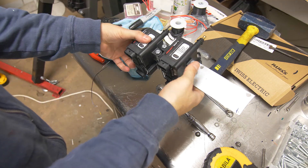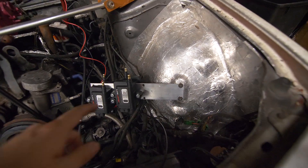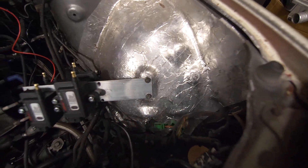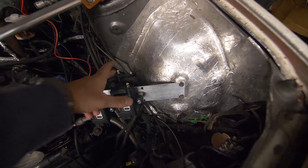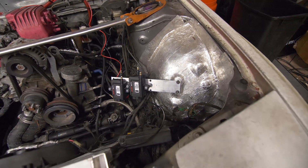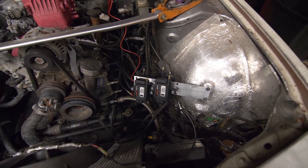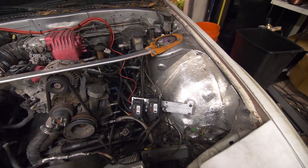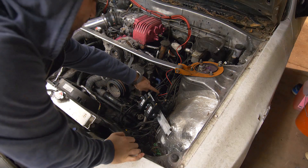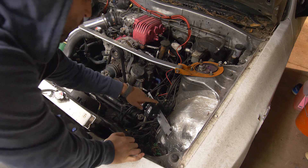Here are our coils in their final mounted positions — now we'll just mount this to the chassis. I couldn't quite get it to fit using that third stud, but by moving this to the right it works. It seems pretty sturdy and it should be easy to wire up to the spark plugs as well as the 12 volt power source. I'm going to assign these as: front lead-in, front trailing, rear lead-in, and rear trailing.